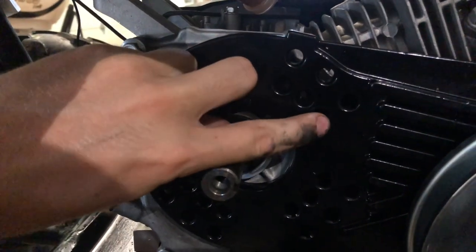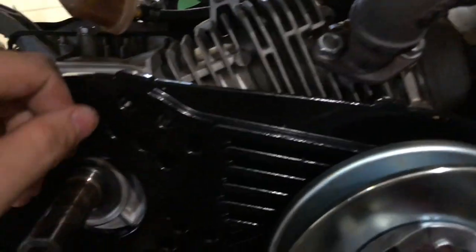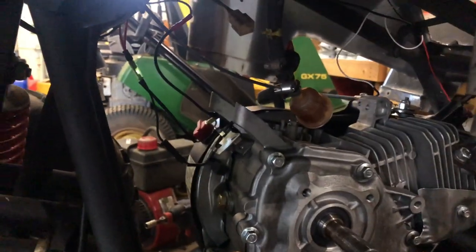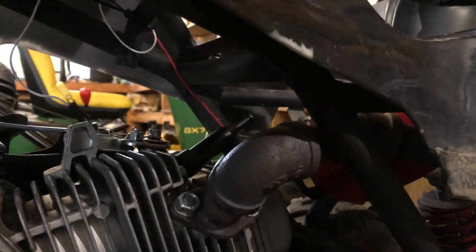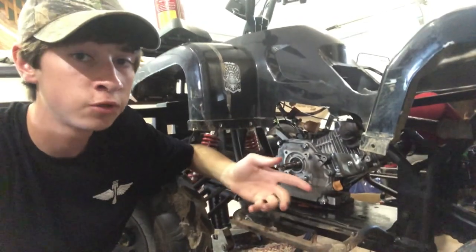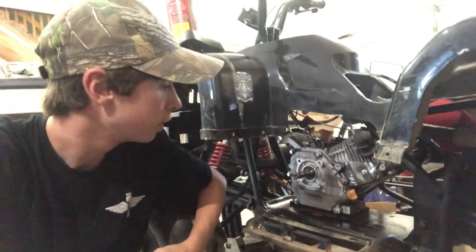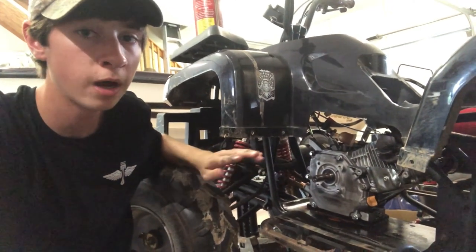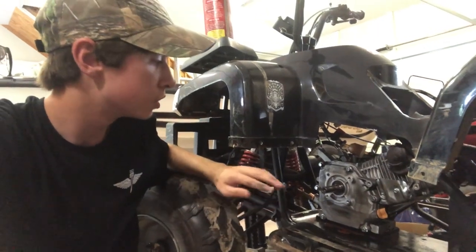It can't go in the third hole because it hits the back of the cylinder, so I'll have to put it in the middle holes. To do that I'll have to raise the engine up. Up front there's a good amount of room to raise it. In the back, the exhaust might hit the frame, and this little brace will have to get moved up too. I'd much rather raise the engine than cut part of the chassis out, though if I have to I will — I can always weld extra supports in.